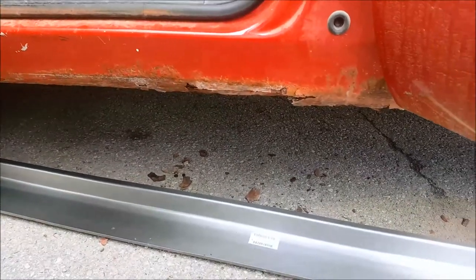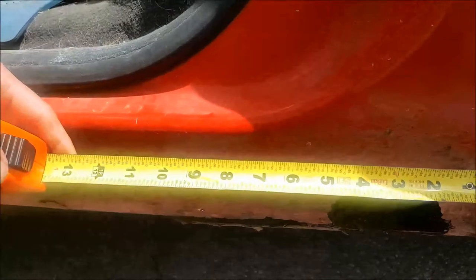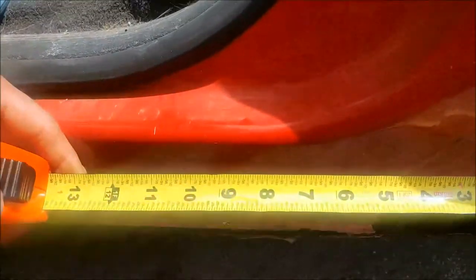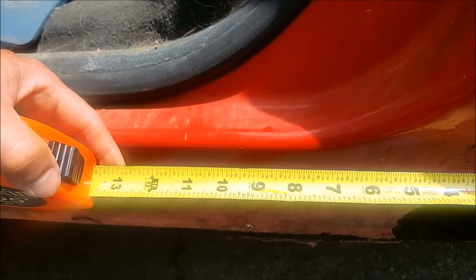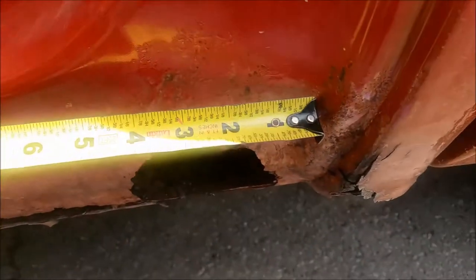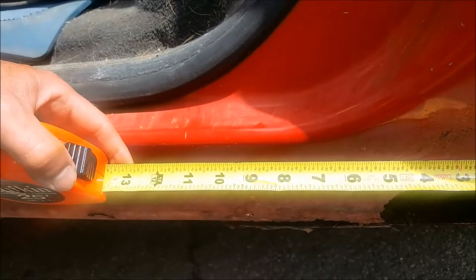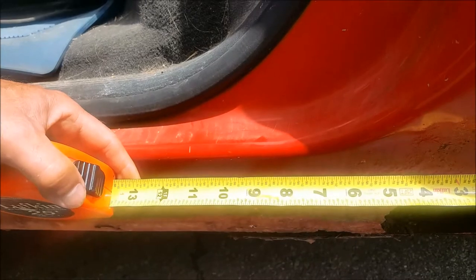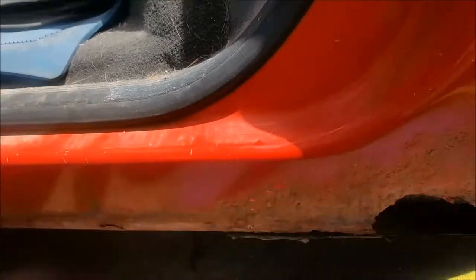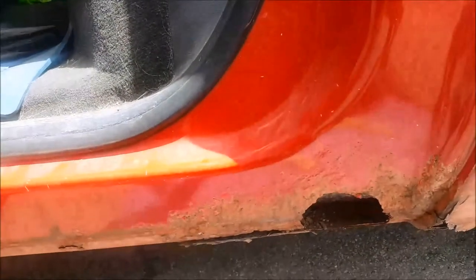So I'm going to work on that and bring you along. It's about eight and a half inches until you bottom out of the radius on the sill and come back into this area. Just kind of ballpark it — you fit it up the way it fits, and after laps and gaps it all fills in. So there's eight and a half inches. Going to mark that on the panel and then cut it out.